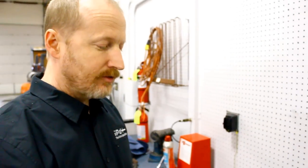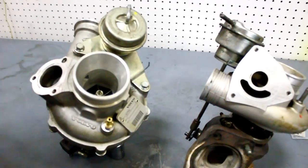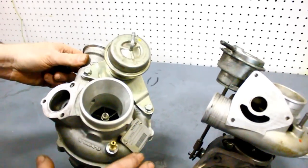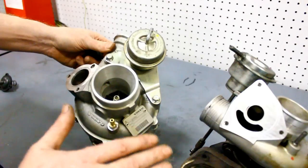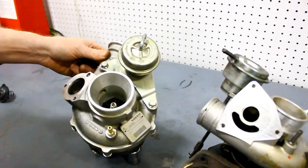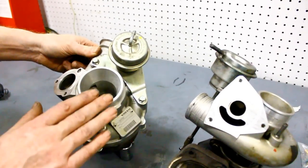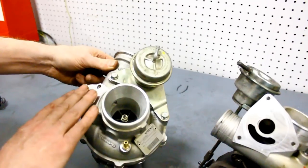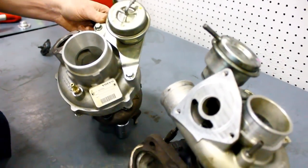Another factor to consider: since neither of these bypass valves actually seal very well due to a couple of different issues, your turbo has to work harder to hit your boost target. If you're reaching for a target of, say, 15 PSI, it will actually have to spin even faster to try and reach that 15 PSI, because some of the boost is actually being accidentally wasted through your bypass valve while you're trying to make boost.